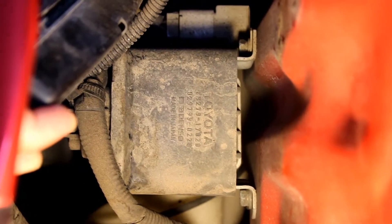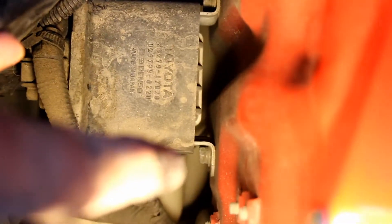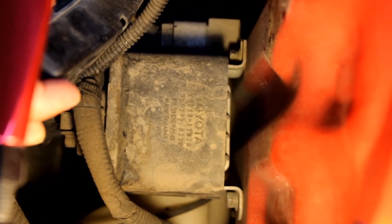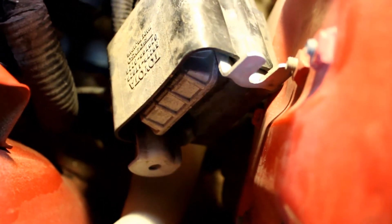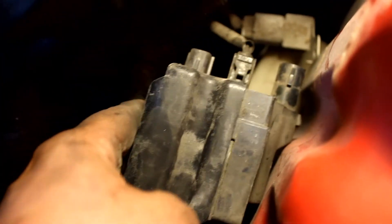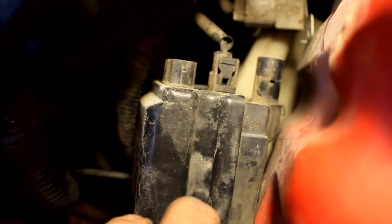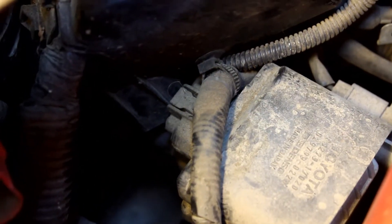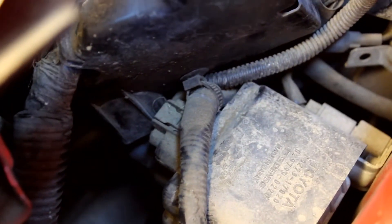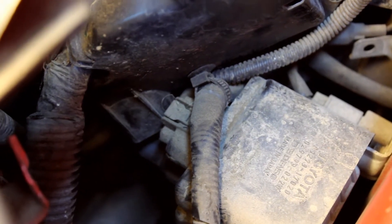When you get the fuse box out of the way, take out those two bolts and the coil is mounted to that so you have easy access. The passenger side of the coil has a notch so you don't have to take that bolt all the way out — just loosen it. The driver's side bolt you have to take all the way out. Once you get it out enough there's another plug right there — push that clip and pull it off. Before you undo the 10 millimeter bolts, unplug that top rectangle plug and unplug the coil from the distributor.